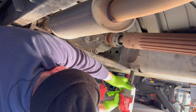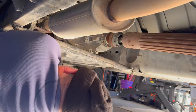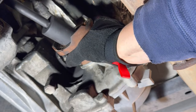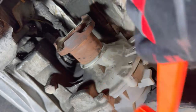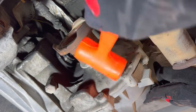I prefer to take the transfer case skid plate off to give myself more room to work — it's an 18mm socket. You need a 1-1/4-inch socket to remove the transfer case flange nut. The plastic mallet just wasn't doing the job, so I upgraded to a ball peen hammer, and you can see the results here.